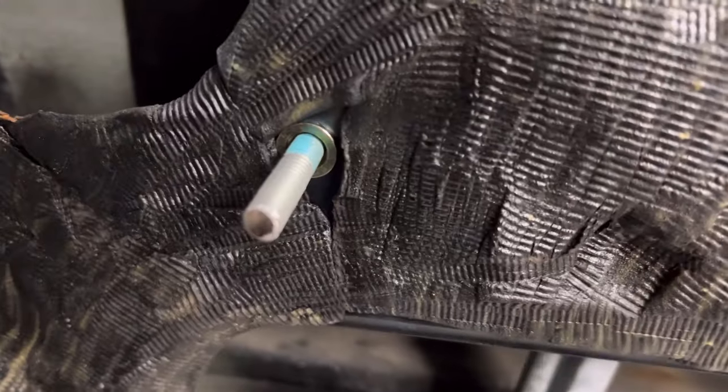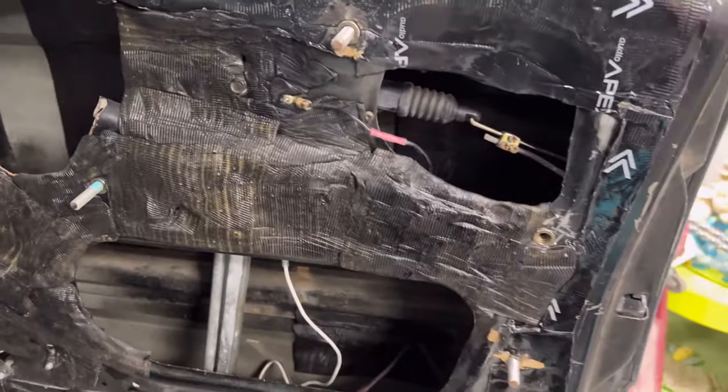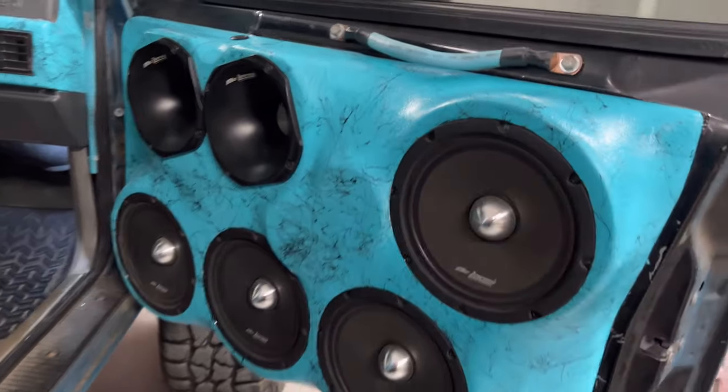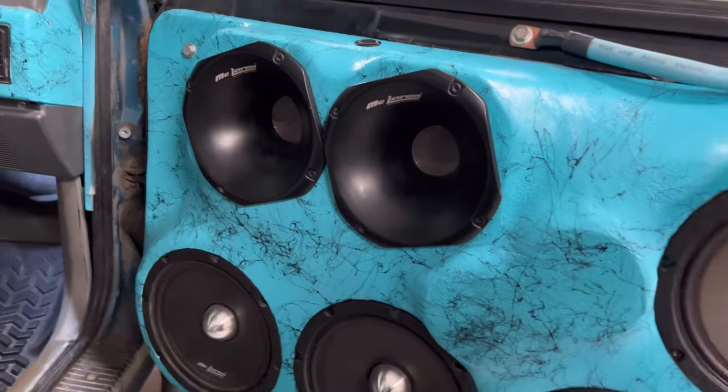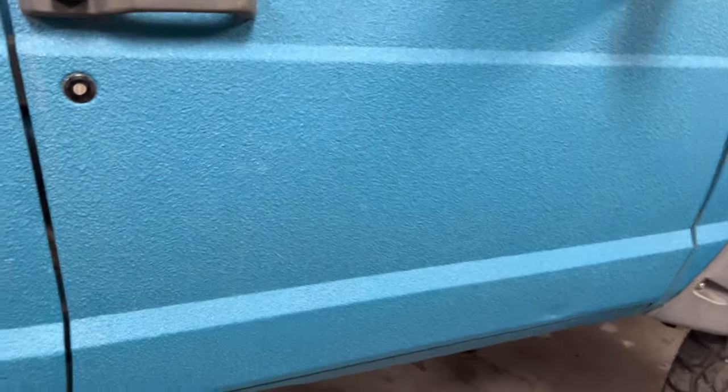All that vibraflex in here — I added a stud right there, so it should be a whole lot more secure than it was, especially in this region where everything was broken. I'm getting my door panel back on and putting this back together. It's all back together — I just checked, all the speakers are working. Everything up here looks good. We got that bolt in there now and added one back here for reinforcement, so everything should be solid. I'm already adding some vibraflex on the door skin.